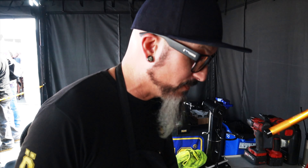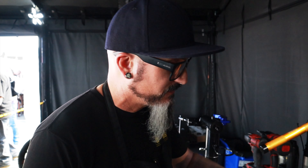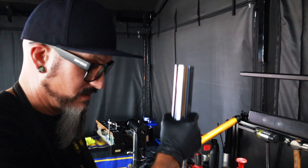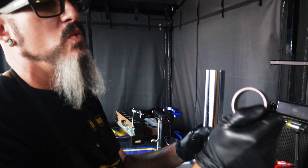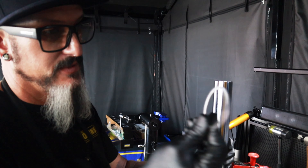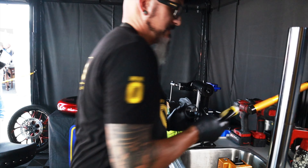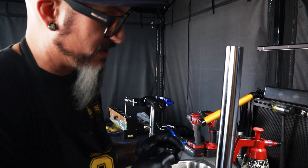The upper and lower tube are completely cleaned out — now it's time for reassembly. First, install the upper bushing, then turn it upside down and place the shorter, wider-diameter bushing on. Add the stop plate, then take the fork seal. I like to use a product called Slick Honey — it's a bicycle product and some really good, low-friction grease. Put a couple of dollops inside the seal.